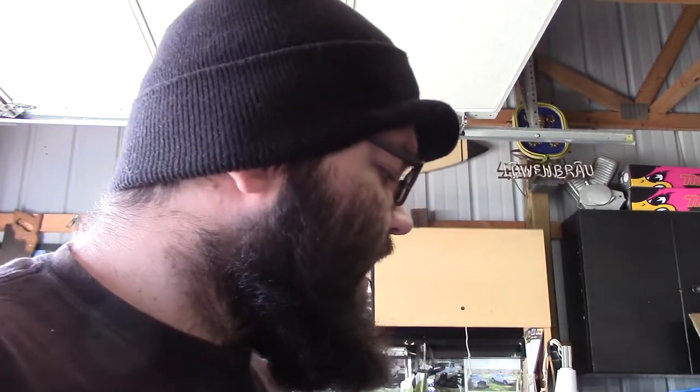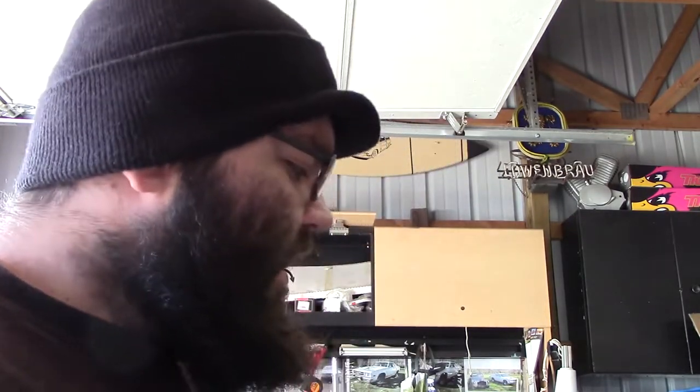Well, yesterday was all the measuring, and I took the wheels off of everything, put everything on jack stands, everything's level. What I need to do now is, I had welded braces to brace the front of the Bronco chassis. What I'm going to do is find the center of that, make sure everything's even again, and then I'm going to tack weld a straight piece of metal to the front, find the middle of the front end, make sure everything's even again, and then tack weld a brace between the Bronco chassis and the front end when everything's where it needs to be, basically. That way nothing's going to move on me.